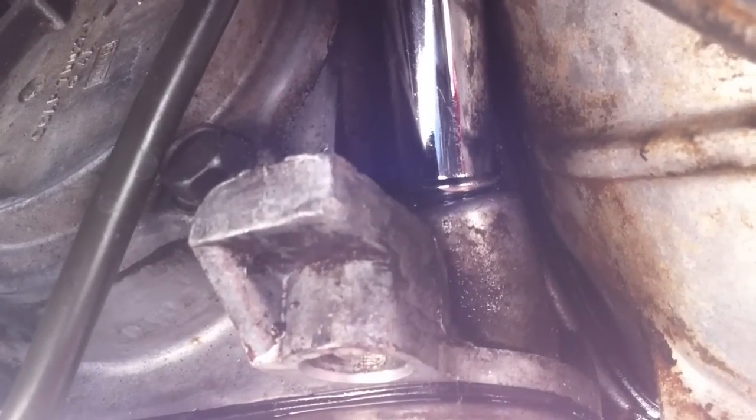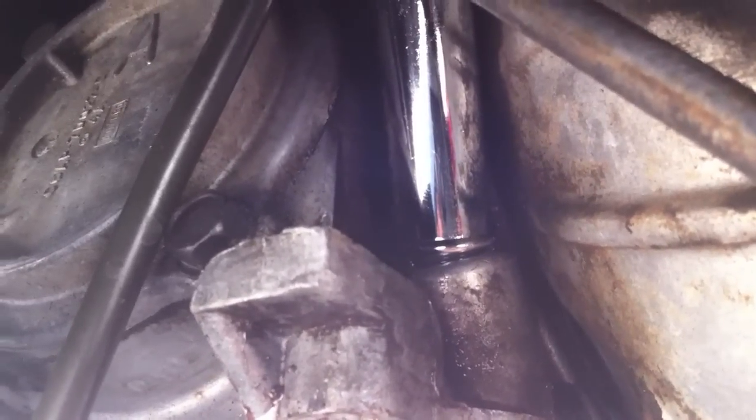Here's a view of the pan right now — it actually doesn't seem too wet. It's possible that the silicone is not sealing with the filler tube, and we could have some leaking going on there, walking back through the gasket and coming down through the back. I'm gonna wipe all this down and ride her hard. Engine's clean — no oil leaks — so the rear main seal and oil pan are a success. It's just a possible transmission pan leak. I might recommend to Alma that we just replace the transmission pan completely.